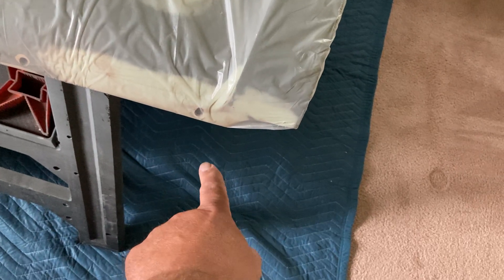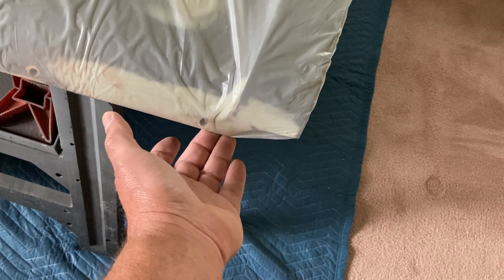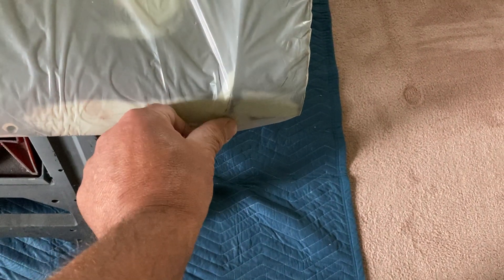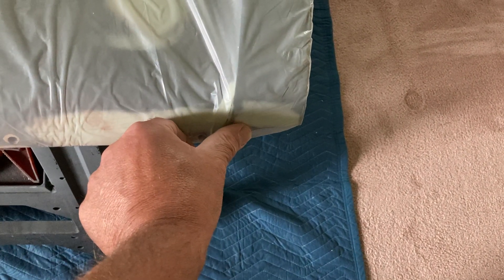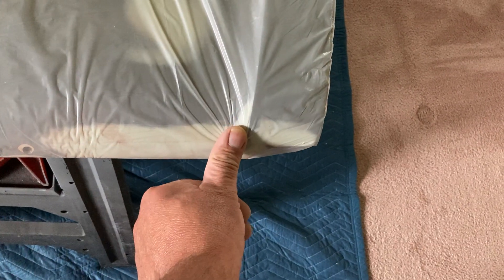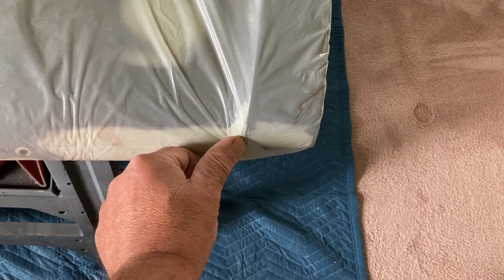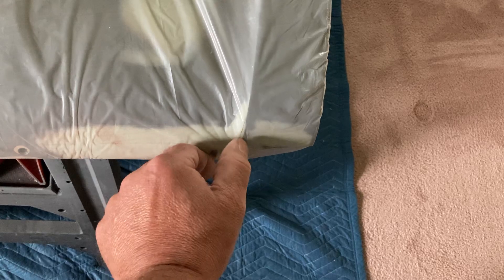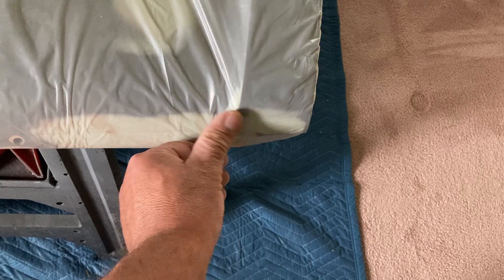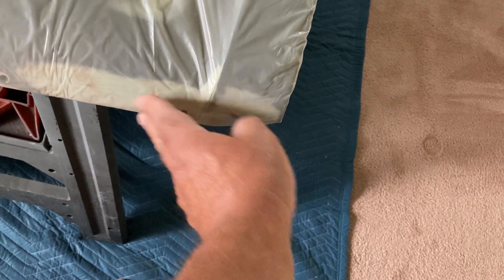They continue the body to meet the rest, so we removed that point and put in a little piece of metal. Also, the front half of the hood was sitting out further than the rest of the hood. The way it's counter-sunken, it's hard to make out on video, but they go flush now — before it stayed a little proud. We sliced it, totally reshaped the hood, welded it back together, ground it, and then did some final smoothing out.